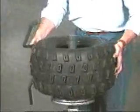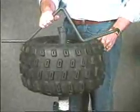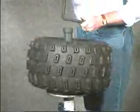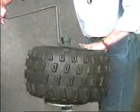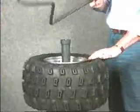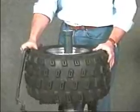The second bead of the tire can be done with the special tire snake or with the tire snake that's included with your unit. Again, cock the tire closest to your body, insert the curved end, and pull in a clockwise fashion, keeping the palm of your left hand against the tire side. This is particularly handy if you change a lot of ATV tires and rims.